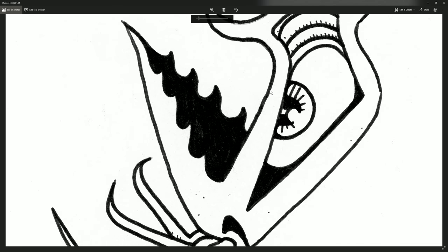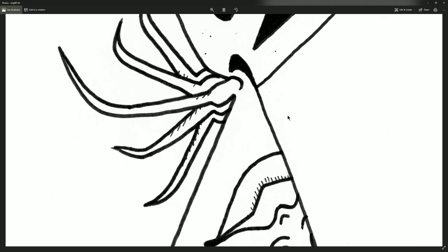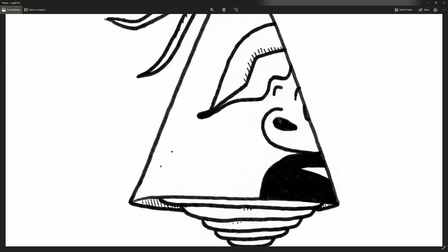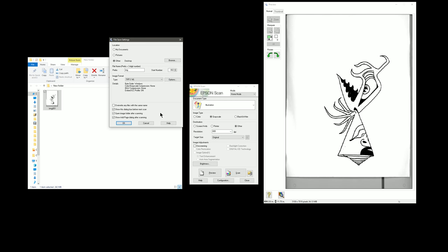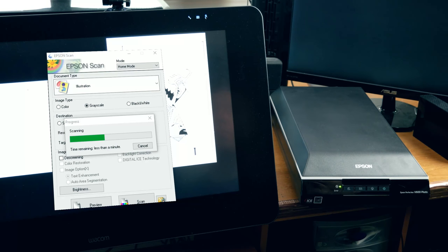However, there are a few fine details which a high resolution scan like this would preserve, such as some of the intentional dots on the image and some of the hatching. Let's create another scan for comparison. I'll set the resolution lower now to a mid setting like 600 DPI. This is actually real time — I'm not speeding up the footage at all — and it's taking under a minute to scan. That's much more reasonable than several minutes like it did on the higher resolution scan.